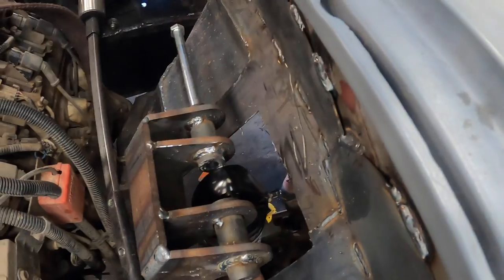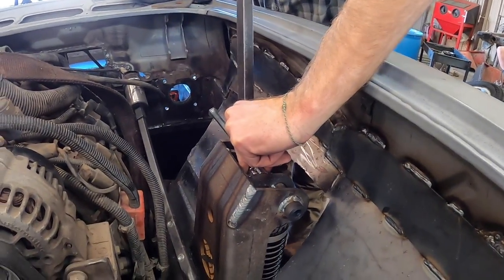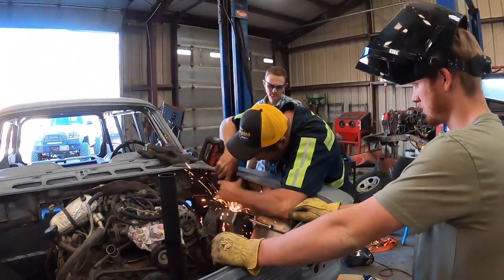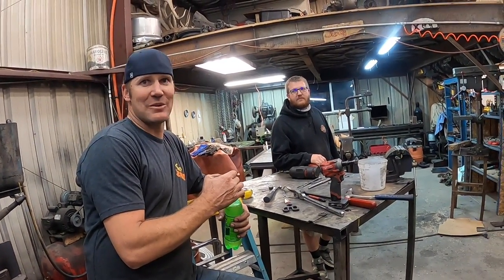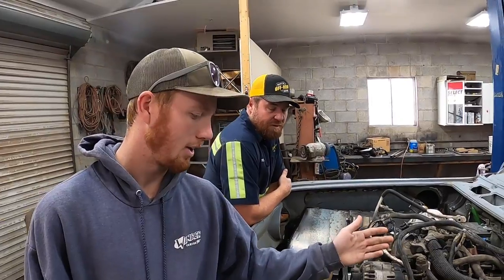End of the day - we actually did more than we planned, just different stuff. Hope the training works. We're back to work here on the wagon project. We went to Fab Rats this weekend - we pulled the motor, transmission, and transfer case and had Paul rebuild the transmission and transfer case. While we were there we also got to put our strut mounts in. While Paul was rebuilding, Rudy was under this finishing the firewall and the transmission tunnel, so that's a hundred percent welded now.